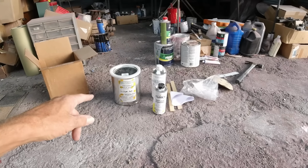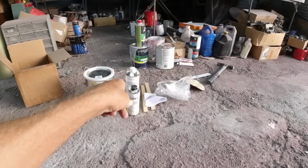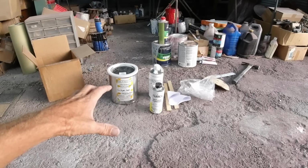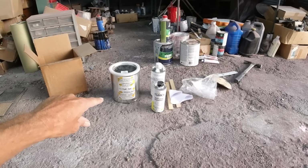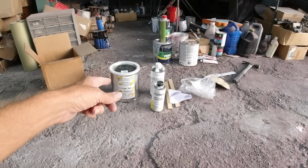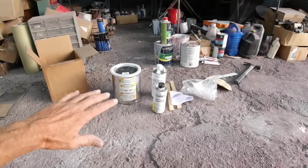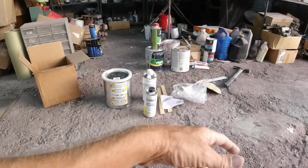And there's no hardener in spray cans. You get a spray can, there's none of this hardener in there, so it never actually hardens. It'll feel hard to the touch, but you can never paint over it. You go to paint over it with, say, this type of paint, it'll all wrinkle. Okay? So it is completely ruined. You've got to take that stuff all the way off.